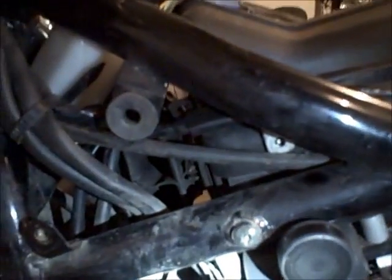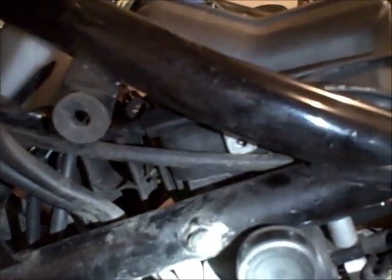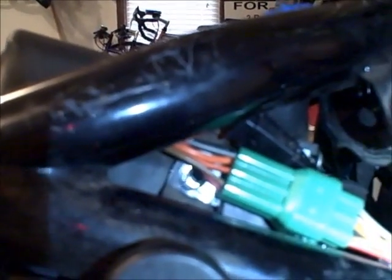It's just under the front two quarter panels. You got to pull off. There's a Phillips head there that holds cables to the air box. On the other side, right under the ignition connector, there's another Phillips head that holds the air box in. Now I'm going to pull the air box out.